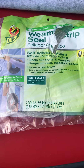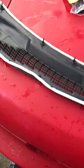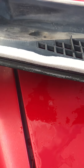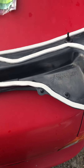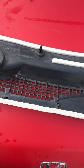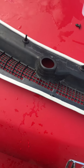The last thing was the weather stripping. It's three-eighths inch wide and three-sixteenths inch thick foam weather stripping — it came in two rolls of 30 feet each, which was well more than enough. This is where your other problem exists. Most people don't pay attention to the weather stripping right here. It's the foamy type that flares back to its normal position. Mine was very old, brittle, and falling apart when I took the cowl off. This plays a big part in letting water seep through to that puddle area on your firewall that leaks.